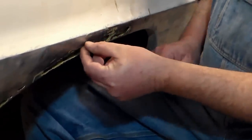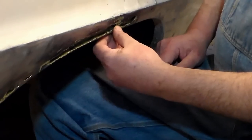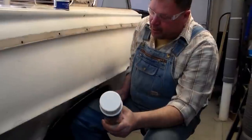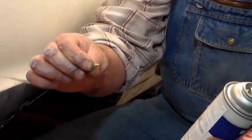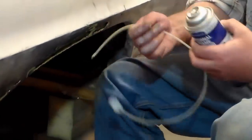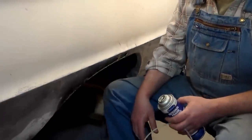I came in here with a rotary file and grinders and cleaned it off until I couldn't see any more rusty surface. Cleaned that all up physically as best I could, and then sprayed it — hosed it down with rust converter to arrest the rust. Further up in there there's zinc chromate primer. It has a little nozzle that finely atomizes the zinc chromate, with four little jets, so you stick it up into all these crevices, spray, and then pull it. This whole area in here has been treated as best I can to prevent rust.